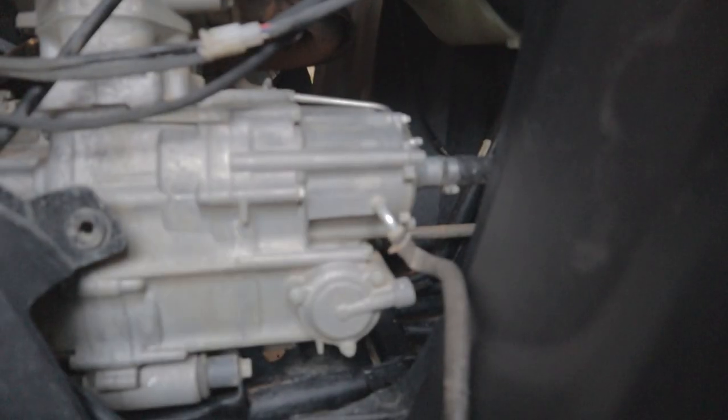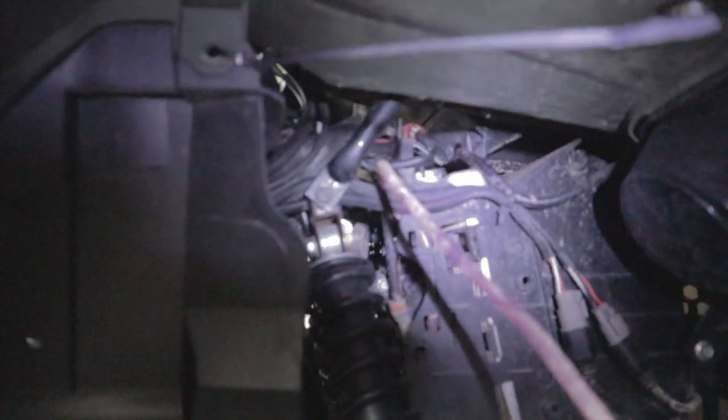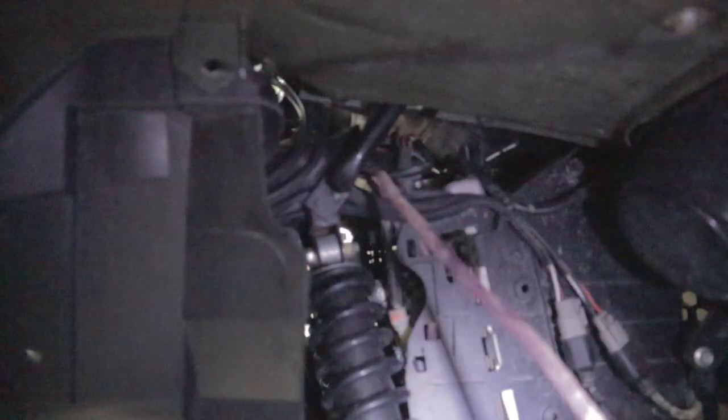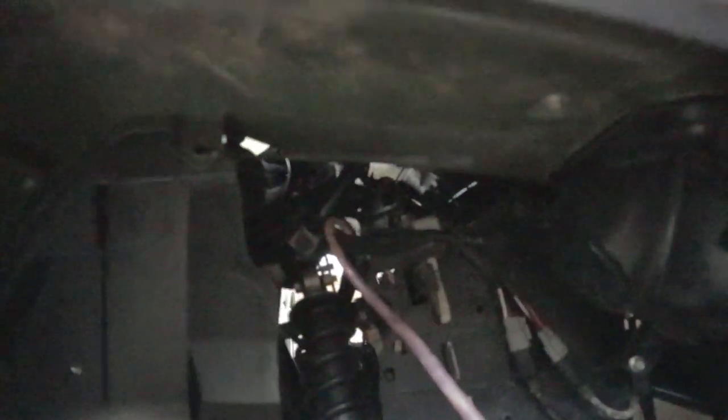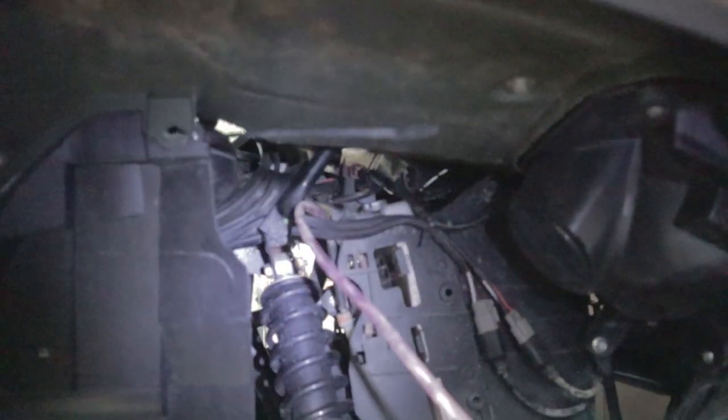Follow me right over here to take a look at the front diff — there it is right on top of that. Then we'll get to the radiator. This is your water pump line, so we'll be rerouting it up to the front also. On the 2019, this red color line right here is for your fan motor. You can almost just disconnect it and put a T and seal it real good instead of fighting it, because it's way back on the fan motor — kind of hard to get to.